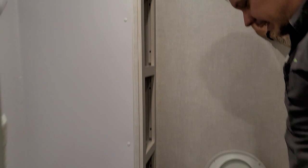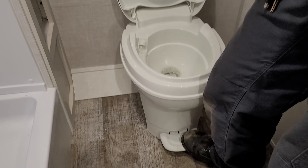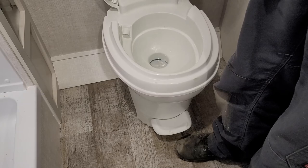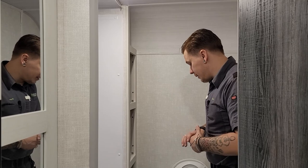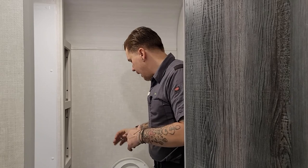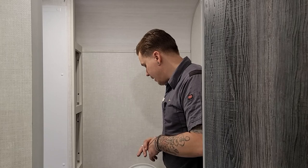Coming into the restroom — our toilet has a light press on the pedal that fills the bowl with water, and then a full press to flush. Any toilet treatments — deodorizing products, tissue dissolver, enzymatic products — are introduced from this location. Just a reminder: use single-ply RV-grade toilet paper so it can break up in the black water holding tank. It's very important to feed as much water to the tank as we can, keeping it in a wet or flowing condition — long flushes are recommended.